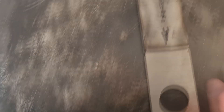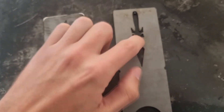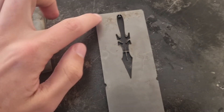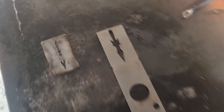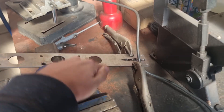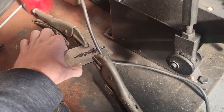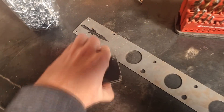I have the little plate made up now. There we go — it fits all nice and neat; it could have been a little bit shorter on the sides, but it is what it is. To mount it, we're gonna use rivet nuts. I just need to mark and drill some holes into this plate, which makes me a little nervous. My dad had the idea of putting the backing plate on at the same time so when we drill it, we drill it all at once and it's done. What's left now is to bend this and paint it.